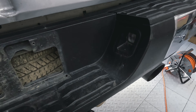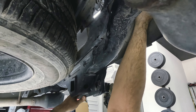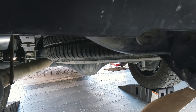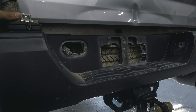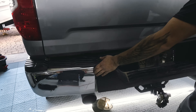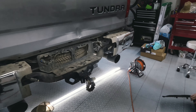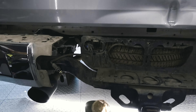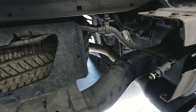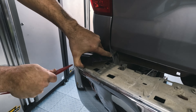Next is removing the license plate lights. Go to the back, twist them, and the bulbs come right out. Do both sides. Then we have everything loose — just pop the top clips and the middle section comes off. You can see your license plate bulbs and harness. The top plastic pieces you can just pry off with your tool, and you're good to go.